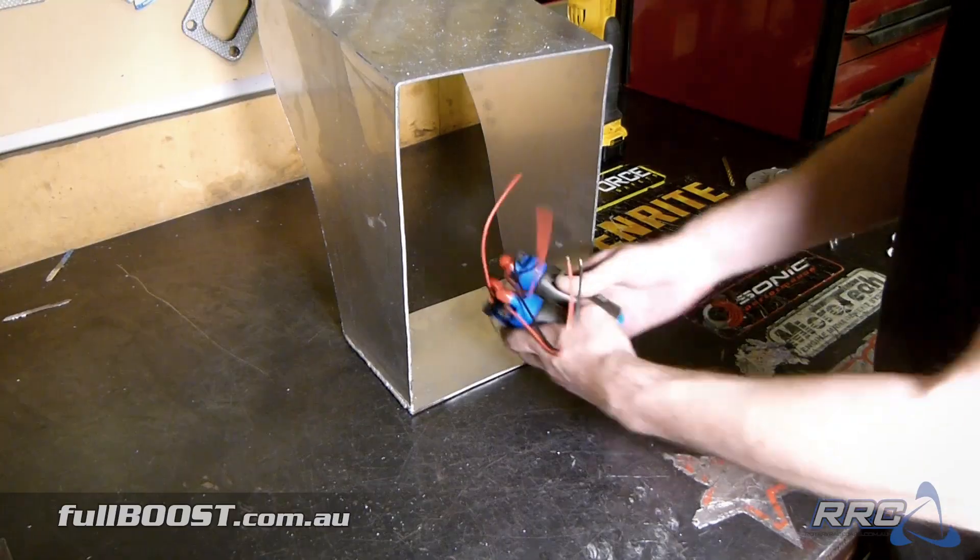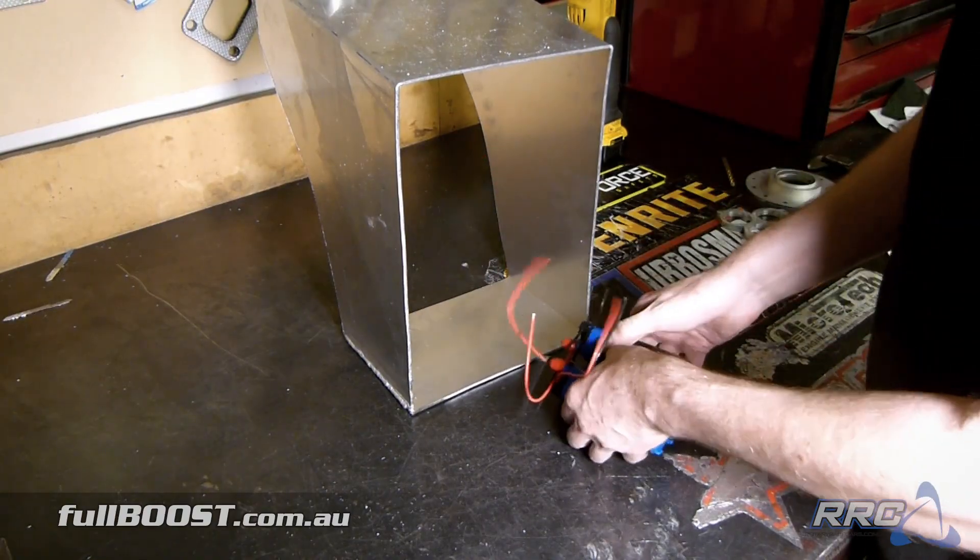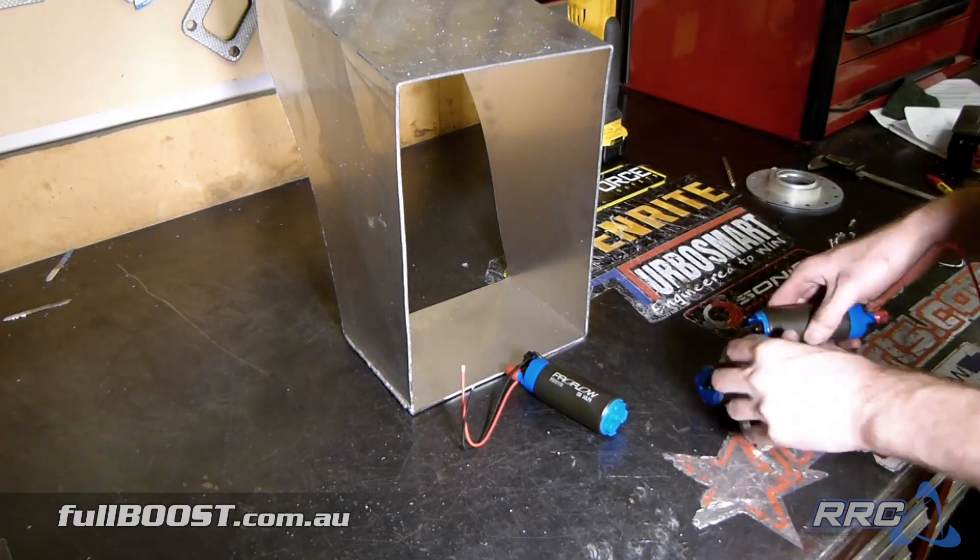Next, we need to shift our focus while the tank isn't completed to fabricating the fuel pump carrier. I've gone a little left of center here for a drag car — most drag cars have traditionally run a big single pump or even a mechanical fuel pump. I've channeled more of the street style setups that I build for customers. I'm actually making a three in-tank pump fuel pump carrier, and these three in-tank pumps will actually supply close to over a thousand liters an hour — more than enough for the power setup on E85. It also allows a little bit more room if we want to run some more boost in the future. And if we do want to make a mechanical fuel pump work with the car later, it'll still be the same fuel cell and it'll still work fine.